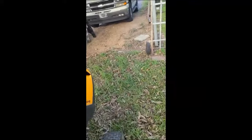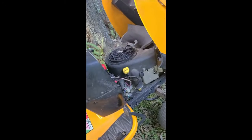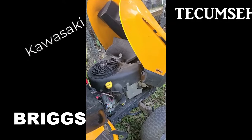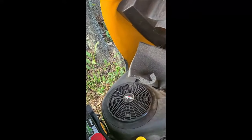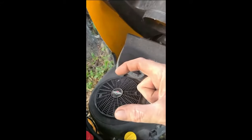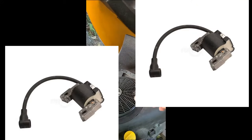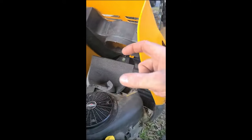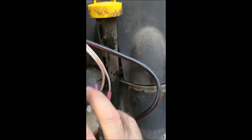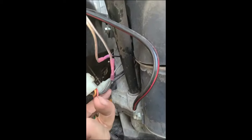I'm probably making this more confusing than I should be, so let me back up — this is very, very simple. Whether it's a Briggs, Tecumseh, or Kawasaki, it doesn't matter. Pull the cover off. Because we don't know the wire codes or color codes for all of them, you pull the cover off and if it's a single cylinder you look for your coil pack; if it's a twin you look for both coil packs. Those coil packs are going to have a black wire coming off of them.